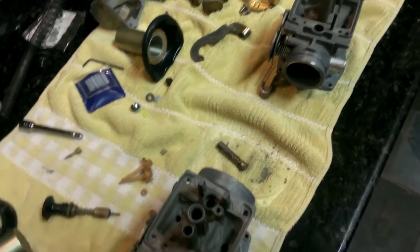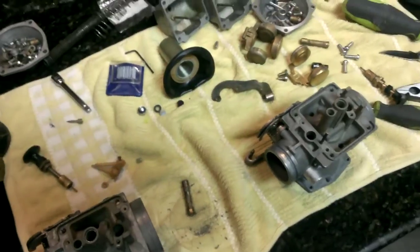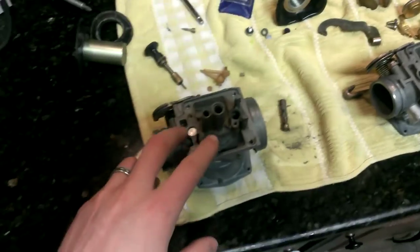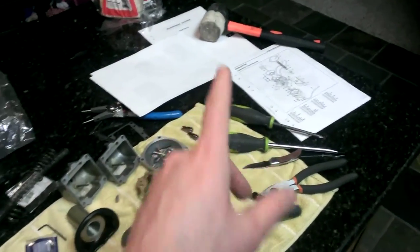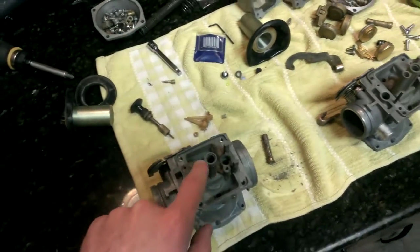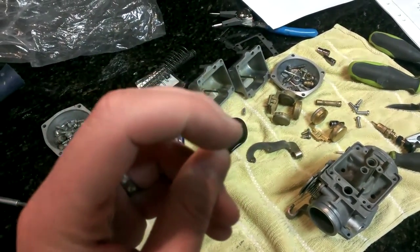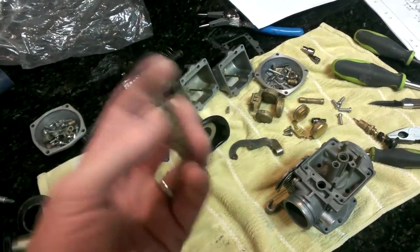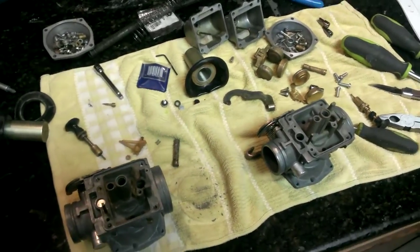It was completely dirty — something I failed to clean over the years. I've had this dirt bike for about ten years now and I never have removed that needle jet. I did end up having to use a regular hammer — a rubber mallet didn't work — and I really had to whack it. I ruined the threads on this needle jet trying to thread it back in the top. This one's crap, but I've got another one. Just showing you how to get that out.